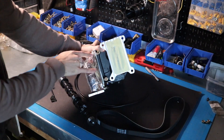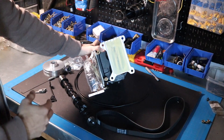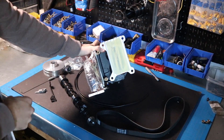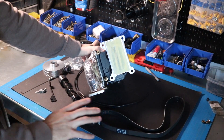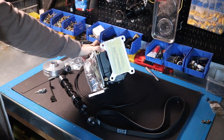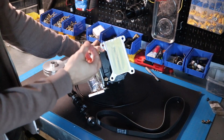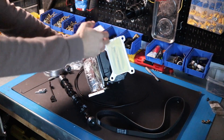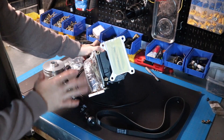On this side, I elected to have him install a charge cooler. You can see there are two fittings here, and this is going to be a separate circuit from my normal cooling system. These two fittings are what is going to be cooling that air prior to it entering the intake system. It's going to be pretty rad — I can't wait to see all this put together.